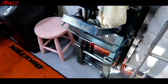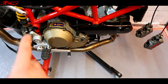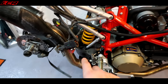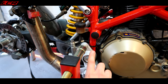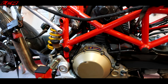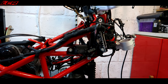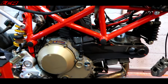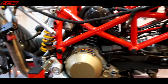I've got an engine lift - and a pink stool - so the engine lift can go under the bike once the exhaust is off, to get it off the ABBA stand. The swinging arm spindle removal can be tricky - I've been told you need pullers and threaded bar. Thanks to the chap who sent me links to a video on how to make your own threaded bar to remove the swinging arm. I'm dreading that removal. Those forks were so tight to get out - I really don't think this bike has ever been apart. It looks very original, so it could be tricky. That'll probably be the next episode.